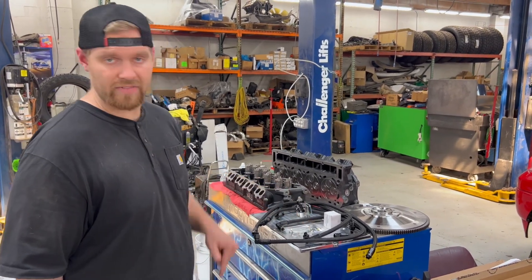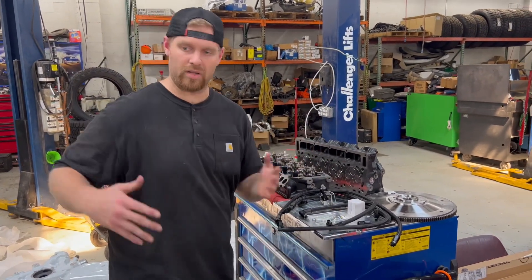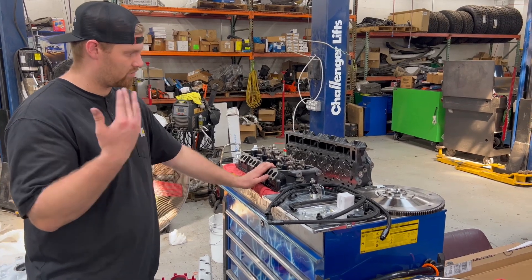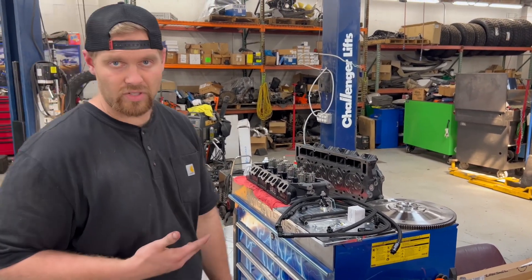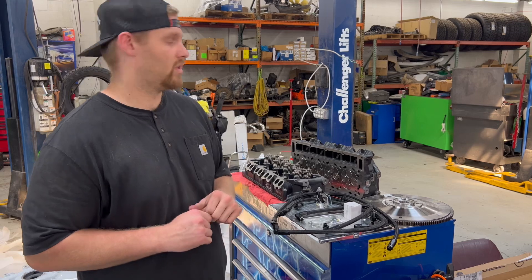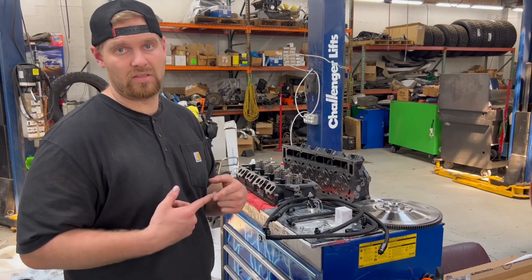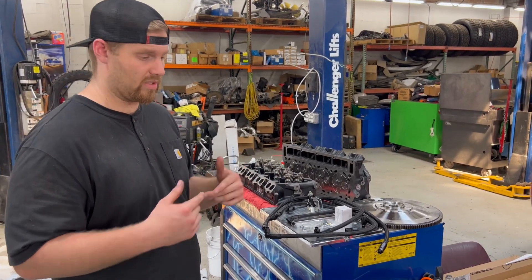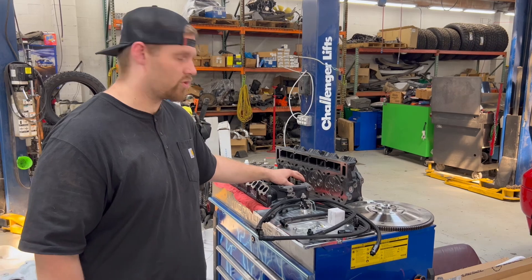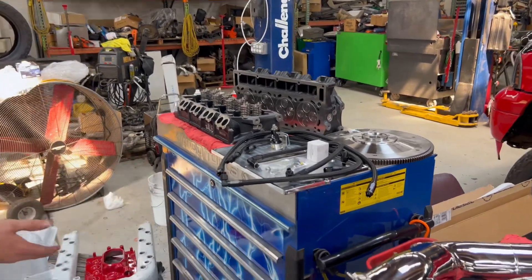Here's another piece from Larry's kit — the billet tray for battery relocation to the driver's side. Absolutely gorgeous, with billet brackets that bolt over as well. For heads, we went with brand new castings from my machinist — I've been using these heads for years with zero issues. He does the O-ring job himself, and we went with one-piece valves since the stock valve is a two-piece spin-welded design that can come apart. For high horsepower we want to be safe, and we've also got 120 PSI valve springs.